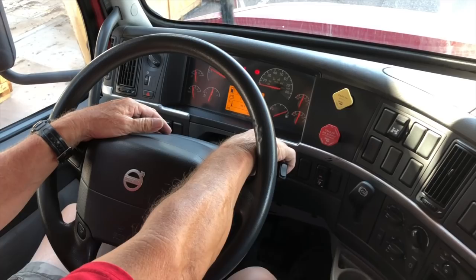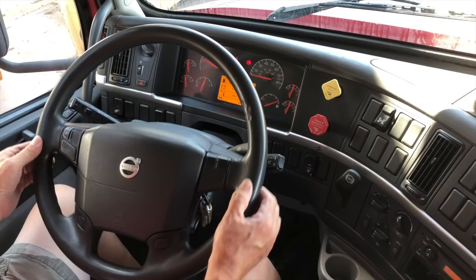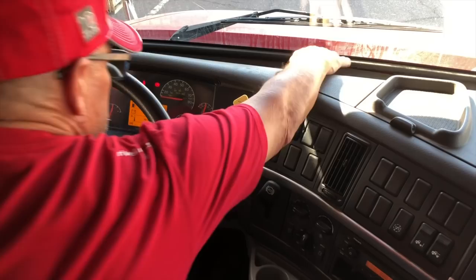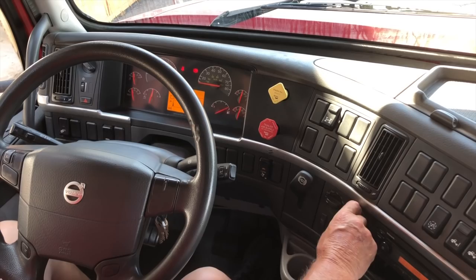On a 20-inch wheel I should not have more than two inches of free play, or 10 degrees. Next I'm going to check my defroster. Next my heater.